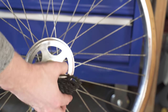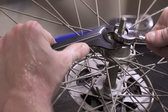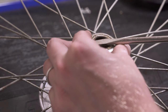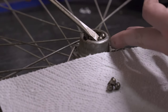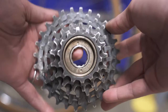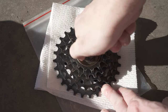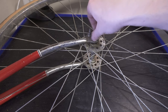This bike has a freewheel hub, so you do need a special tool to get that off. Once you've got it off, a cone wrench and a regular wrench get you access to the bearings pretty easily. The little dust covers are kind of delicate, so be careful flipping those out. These ball bearings just have a lot of old grease on them, but they clean up really well. The freewheel I let sit overnight in degreaser, then Evaporust, then re-oiled it and it's feeling a lot better.